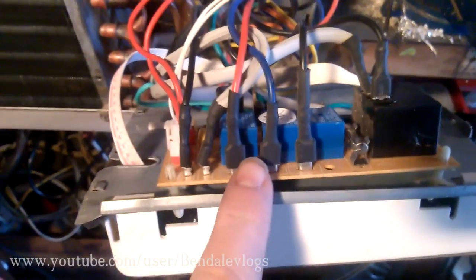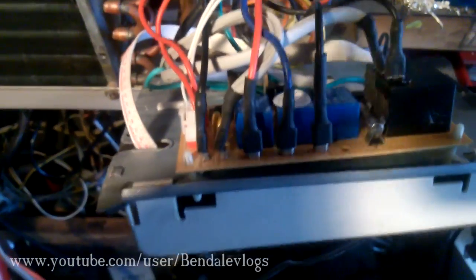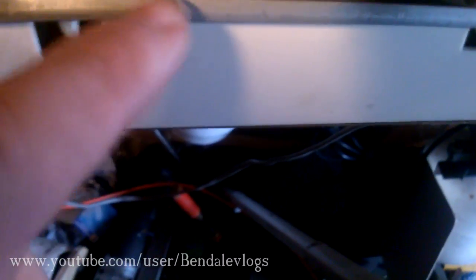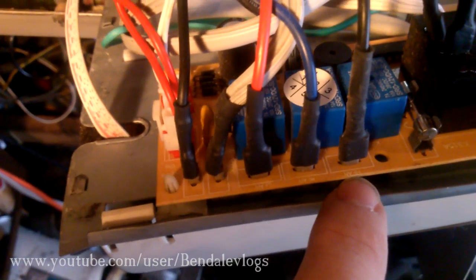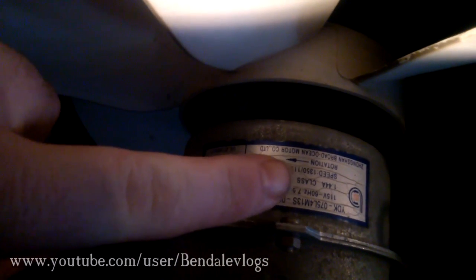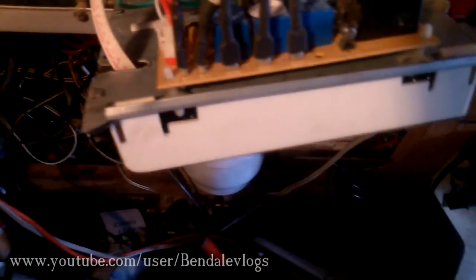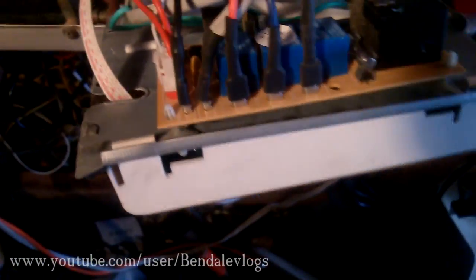Let's get a closer look. These three right here — power goes in here, this one is for the compressor. These three are for your fan. You can see if you look closely this one says H-F-A-N, and they're medium, low, high — those are your three settings. And if you look at the fan motor, although it's upside down, you can see it does say three speeds. So if your fan's running and your compressor's not, these aren't going to be the problem. But if you turn the unit on and you've got no fan, those might be your problem.